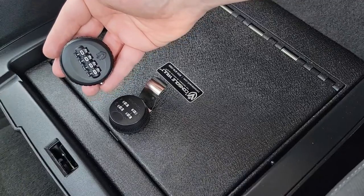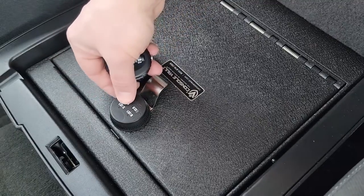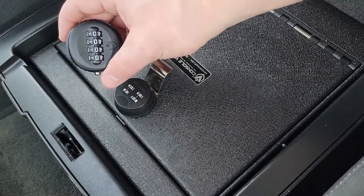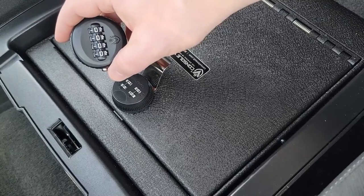The tumblers aren't just easier to see — they're actually easier to use. They're a little bit bigger, and the older ones just don't turn as easily. I'm going to show you how to install the elite four-digit lock, and it's only going to take a couple of minutes with a seven-eighths socket and a Phillips head screwdriver.